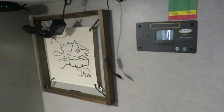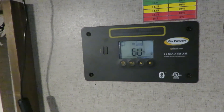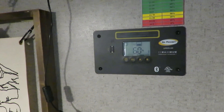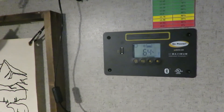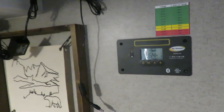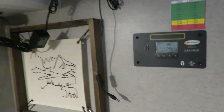The awning does take a lot of juice. I was sitting at about 65% and it drew down to 59% as I was pulling the awning in, then back up to 60%. The main thing is to have enough power to bring the awning up, and then it'll gain back up after a while — it's gaining about half an amp off the solar right now and just went back up to 64%. It definitely draws it down when you pull the awning in, but if you're worried you can hook it up to your car for extra juice.